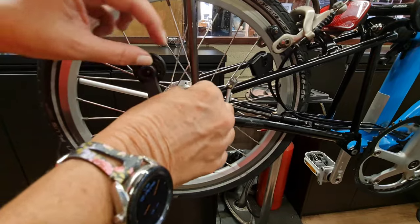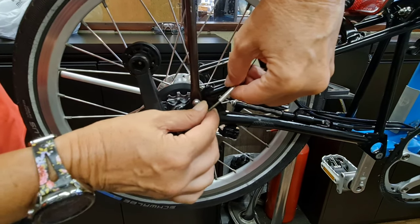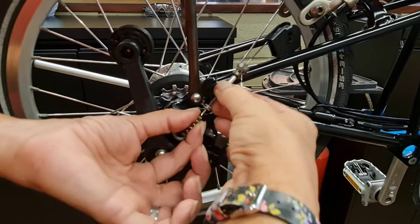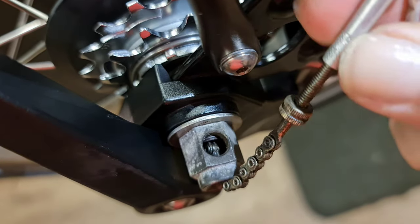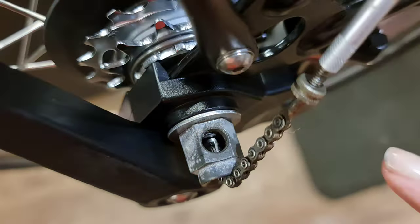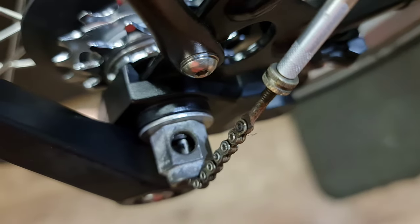Okay. Now, if it stays like this, you never force it to go over here. You always go back and go over here. So now we put it on number 2, already on second gear, because we are going to adjust it. And how do we adjust it? That's the best part. You turn until you see the beginning of the straight part. Not yet. You need to turn it until it fits this here. Okay, when you get the right adjustment, turn this part until it locks. So your adjustment will be right in place.